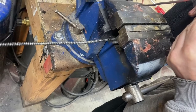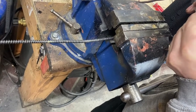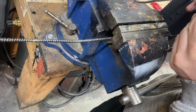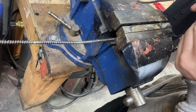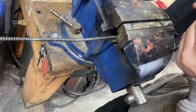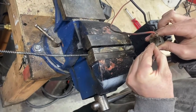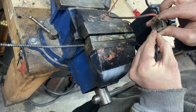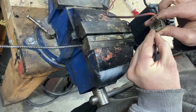And then change speeds. Changing speeds requires two connections to be made for slow, because this has an anti-wound magnetic wire on it to make it go slow. So slow is additive — two coils fired. Fast, only one coil.